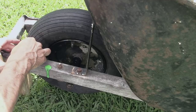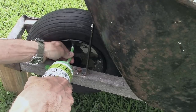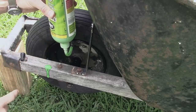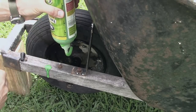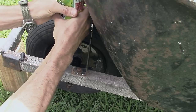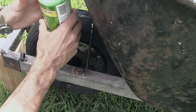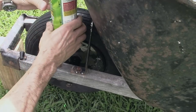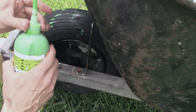So I'm going to put the pin down and the tool down, and now we're going to take the bottle, and it says I should put about eight ounces in. I'm going to slide it right on there. I'm realizing I'm going to have to hold this upside down, so I guess I'm going to be measuring from the top down — we're going to want it to come down to the eight ounce level. I'm squeezing it in. It's going in pretty easily. It's important to have the valve stem up at the top because it's supposed to be pooling down at the bottom. It's kind of oozing over the cap too. I accidentally unscrewed the cap a little bit as I was doing this. That seems like about eight ounces right there. So I'm going to remove this — it's probably a little messier than it needed to be.